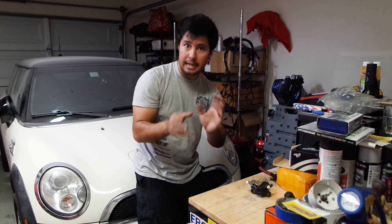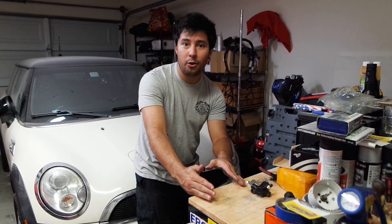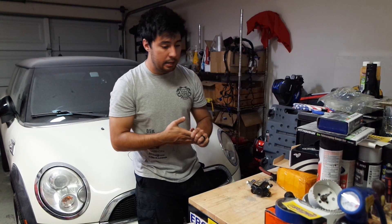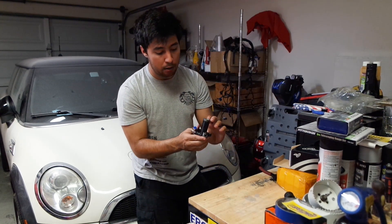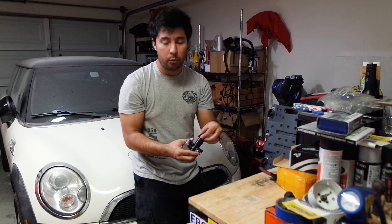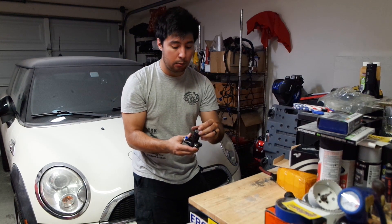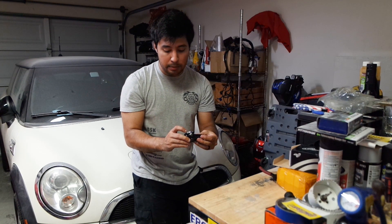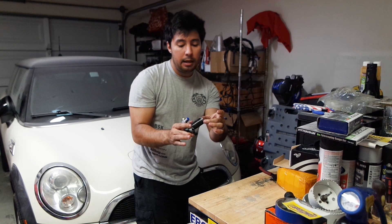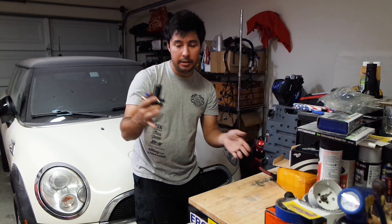It's not exact — I did a little rounding to get to the easiest nominal value, because it's very hard to order or manufacture a piston to such a weird off-spec. So I have here a unit from the front wheel drive model. The FWD has a 0.82 inch bore, which is a little bit bigger and closer to what I want, which is 0.875. That means a little bit less machine work — it's like 6.5/8ths, in between 3/4 and 7/8.